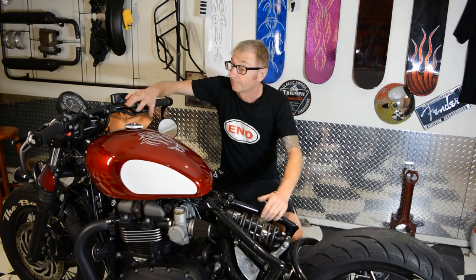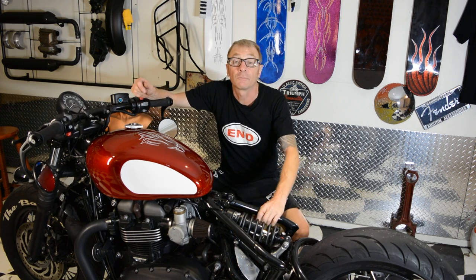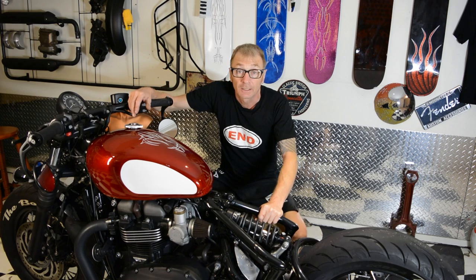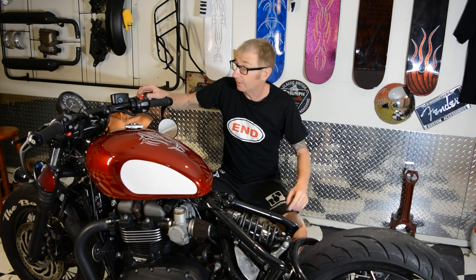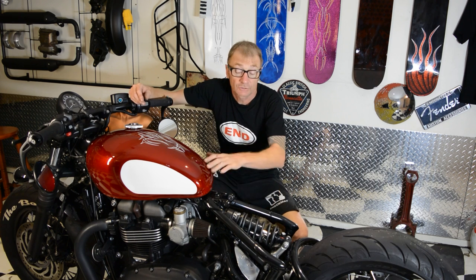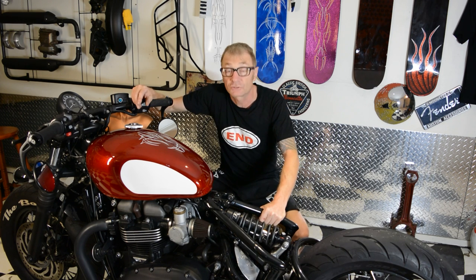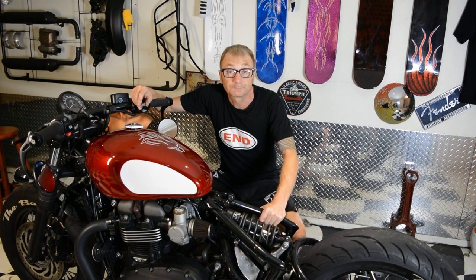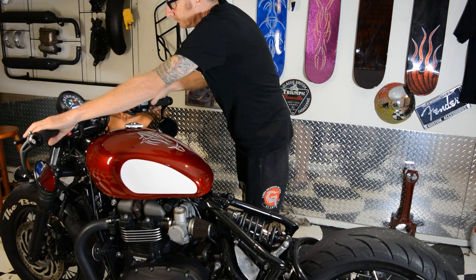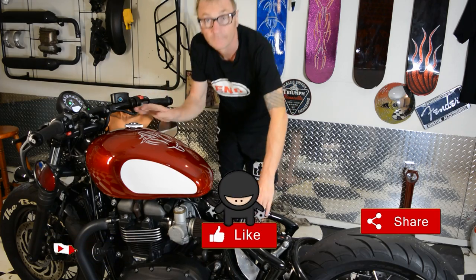It starts — right, so it starts up all right. I've replaced the sensor on the gearbox for the gear position because the one on here wasn't actually working at all. I've got one off my other engine and put that on, so now it's registering all the gears. I've got to put a chain back on and the rear guard — I had the guard off to clean it. In the next video you'll see we'll be riding it and I'll let you know what it's like. But before that we're going to flash the ECU with the street twin tune, because this has got a bobber tune on it and the timing's a bit too far advanced for the higher compression. That's going to be a whole new separate video. Have a great day.